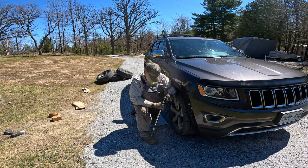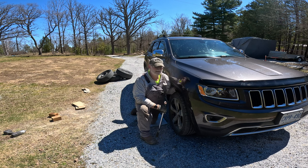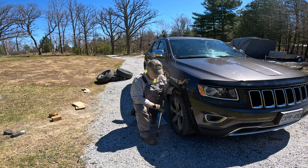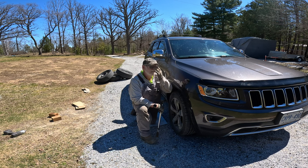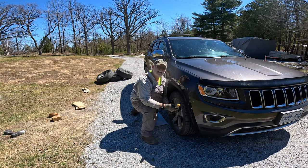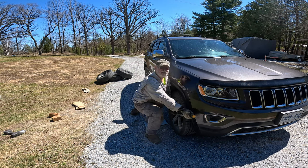There's the first job done. Now, if you're doing this yourself, make sure that after you've changed your tire and done a little bit of a drive — not more than 100 kilometers — check the torque on your wheel nuts to make sure they have held. Steel rims aren't too bad, but aluminum rims are a bit notorious for these nuts coming loose. So 100k at the most, probably 50k at the least — make sure everything's tight.